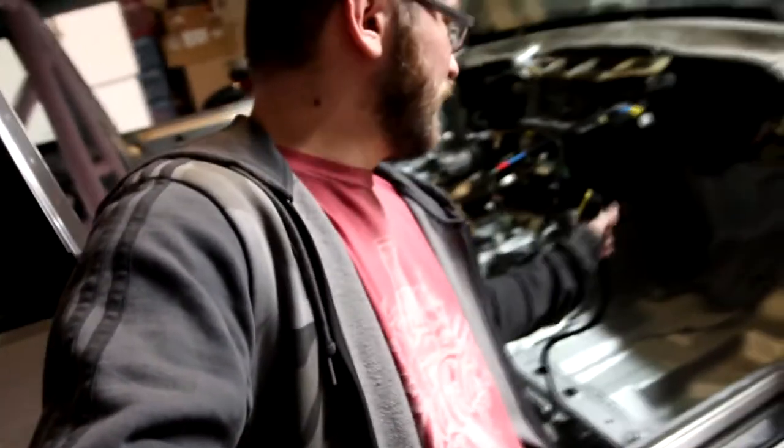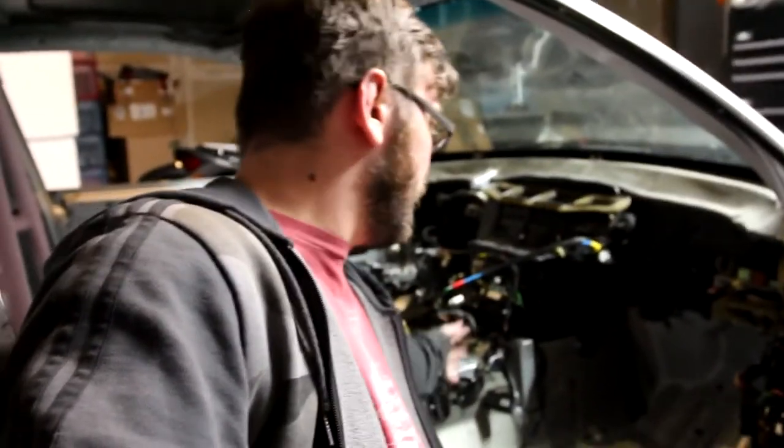I put on a jacket and closed the garage door — there was actually a storm coming, plus the garage stays warmer than outside anyway despite it finally warming up. The plan today is we are going to go ahead and reinstall the crossbar as well as get the steering column back up and tidy some things up in here. I do want to get the dashboard in but I don't know if I'll have time in this video. There are a few things I need to tidy up first — I've got these wires down here for the airbags and the seats that need to get out of the way. They were tucked under the front carpet but now they can't do that. And since I've decided I'm not going to put in the window switches, I need to get these window switch plugs out of the way of the shifter.